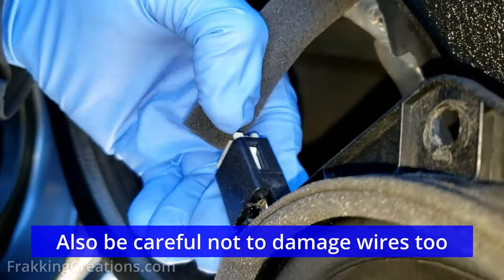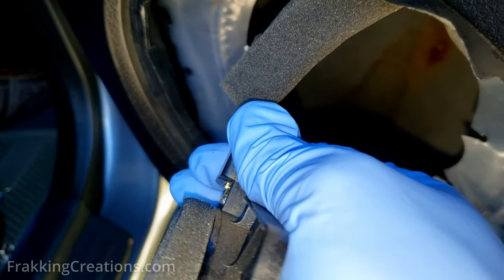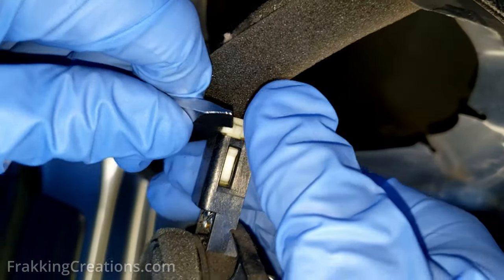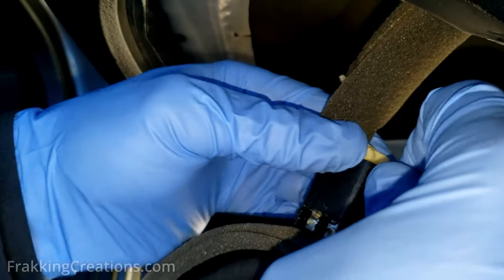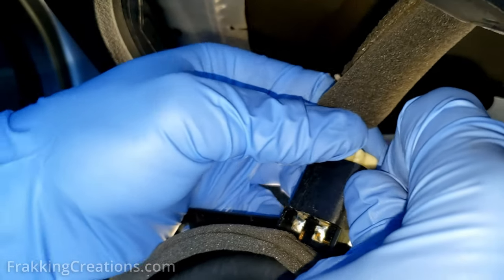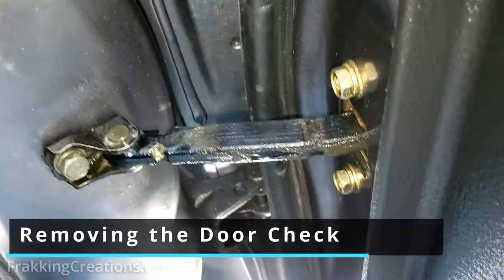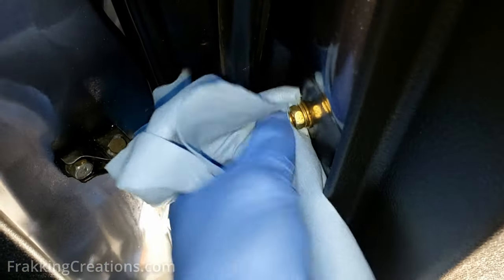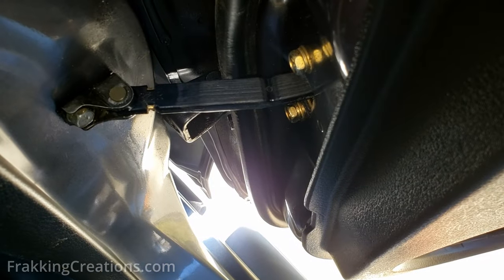Just carefully detach it — you don't want to damage this sheet as well. You should be able to take this clip out so that you can have access to inside the door. Just carefully see where it clips on. In this case it's a little hard for my fingernails, so I'm going to use this bit and just push it out. Okay, it's a bit greasy, so we need to wipe it off so that we don't dirty the car as we take this off. Okay, that should be good enough.